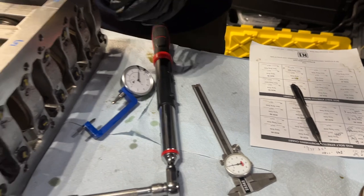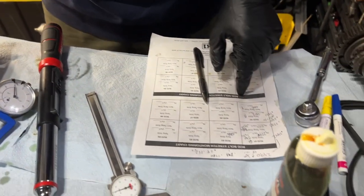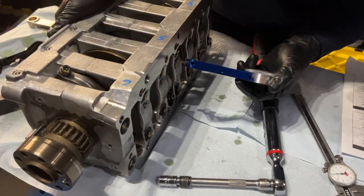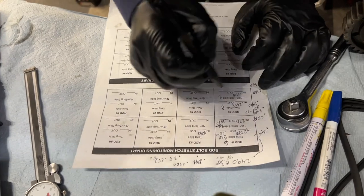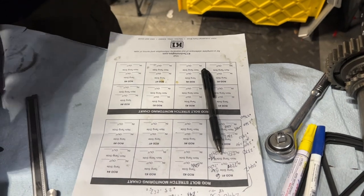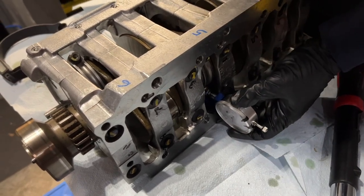All right. Did we measure these bolts? Yes, we did, but I'm going to remeasure them just in case. Make sure we put blue with yellow this time. Yeah, no kidding. Actually, the yellow mark is almost worn out. 0.2415, so that is 0.0055. We wanted to get that 0.0070, which is consistent with the other one. So another 15 degrees to go to 75 degrees. I think it'll get us there.